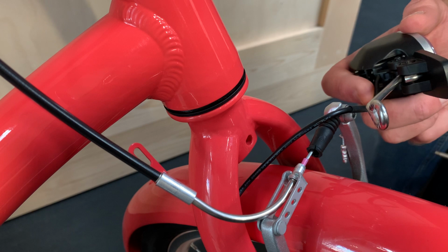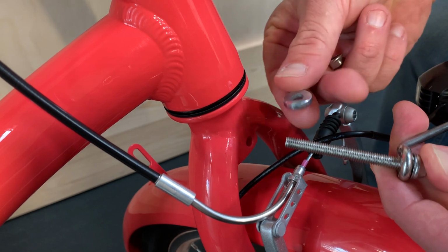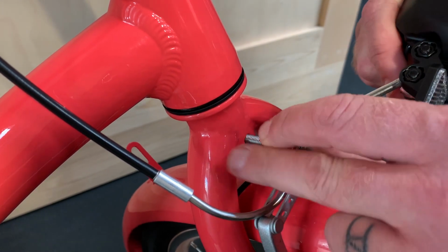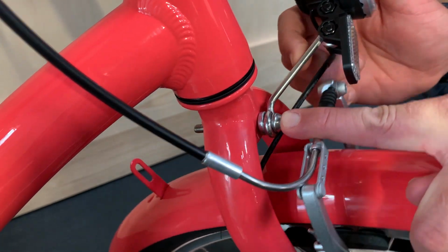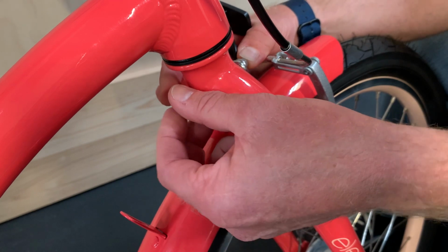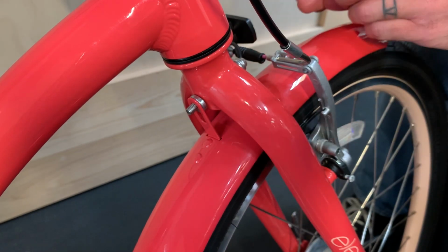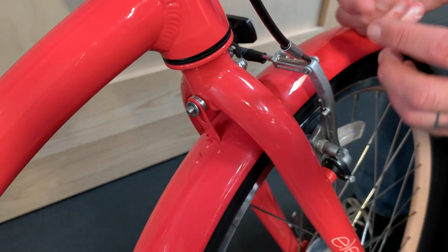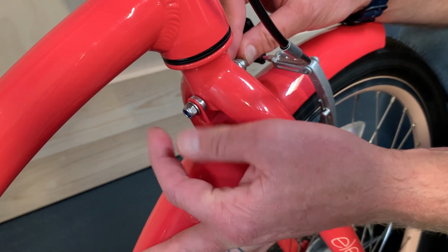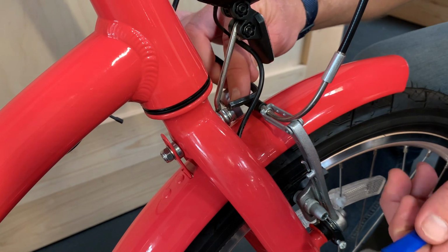We will now attach the fender and the headlight to the bike. Using the fork crown bolt, pass it through the headlight, and then use a curved washer with the curved side facing the fork crown. Pass that through the fork crown hole, and then use another curved washer on the back side, and then the fender tab, and then place the thin washer and 10mm nut on the back of the fork crown. A 5mm Allen wrench and the 10mm box wrench can tighten it all up to about 5 Nm.